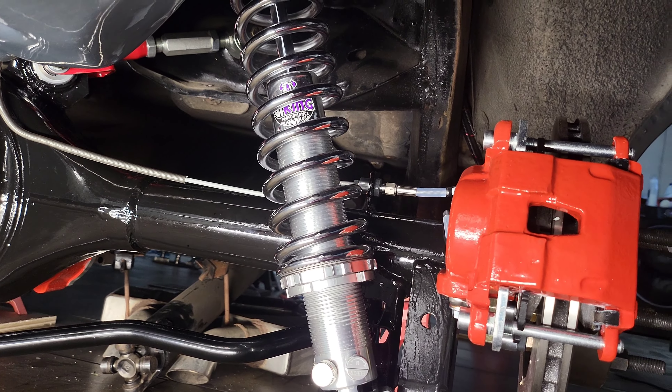As you've seen, the proportioning valve is changed. The top line is tightened up. For those rear lines — I was going to put little tabs on the housing but I don't think it's going to make any noise; it's pretty sturdy. If I need to I'll add zip ties but I don't think I'll need it. There's the loop in the braided line I was trying to show you earlier, and there's the 45-degree Earl's banjo. Changed the brake pads as well since the ones that came in the kit weren't to my liking. That's it — next one will be a coilover video. Thanks for bearing with me, see you in the next one.